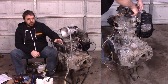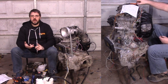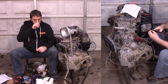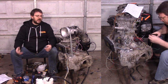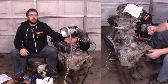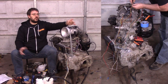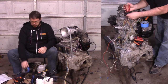Those are all the common wires — things like 5-volt sensor supply as well as sensor grounds. The other things I'm throwing over there are things like injector power, ignition power, all the power rails. The reason I'm doing that is so I don't end up with multiple splices, so I don't forget — like the fact that the mass airflow needs two grounds. I did forget about that, because this is actually acting as two sensors: the intake air temperature as well as the mass airflow sensor. By having them all just dangle over the edge, and using masking tape to mark their purposes, I just regroup them all together at the end and put them in the appropriate places.